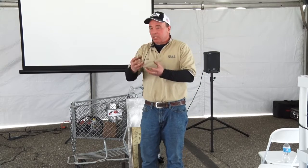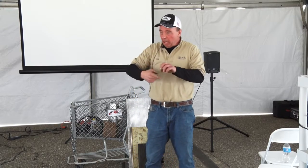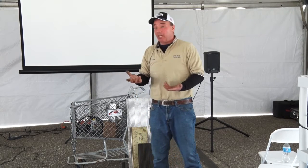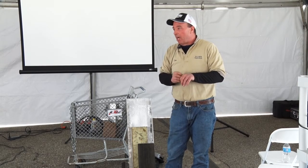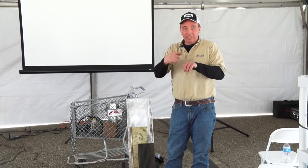Wait an hour and a half, 2 hours. Let that grease get back to real thickness, then move the trailer. Back it up and forth, around. Get the bearing coated with grease again, then unhook it and park it. Now you've put a good bearing grease all over the bearing, and there's less chance of it rusting and going bad on you. Because that's what most trailer failure is for wheel bearings. It's not overloading, not lack of packing, it's they rust because of condensation. And the bearings get little pits and they just disintegrate.